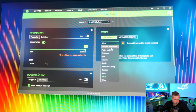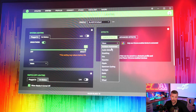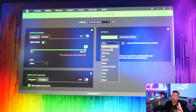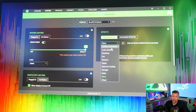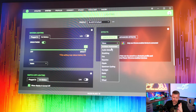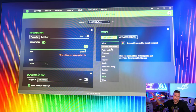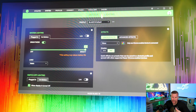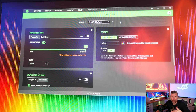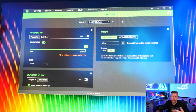I'm going to check chat real quick. You can always replace the battery though. Yes, you can, but if you don't want to have to replace it, lithium-ion batteries, when properly maintained, should last 10 years or longer. So, you know, all these people that have had to replace the battery in their laptops for so many years, it's just because they're charging it to 100%. If you just charge it to 50% or 80% and keep it there, typically, just keeping it at 80% should extend the life of that battery much, much longer. 50%, in theory, could let the battery survive for like 20 years or something if all goes well. But yeah, that's why all these manufacturers have started adding in limiting your battery charge. Like Lenovo does this now. I think MSI does this now. A lot of different companies have added this feature because it's very useful for making the batteries last longer.